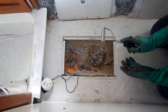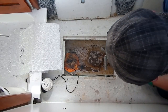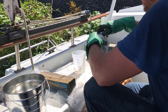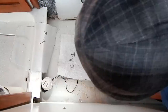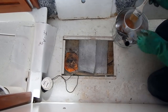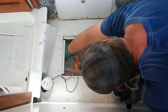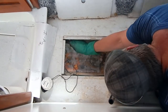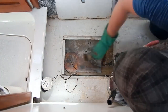All right. I think I'm going to go mix up one small batch so I can lay these two cover pieces in. And I'll do it because this hasn't obviously cured yet. It's going to take a while. But yeah, I'm going to layer that in right on top. Last batch, so 125 milliliters of resin, 25 milliliters of hardener, carrying in my metal bucket for safety. Final application of fiberglass and resin for this repair slash patch job. These two layers of fiberglass mat and cloth that I put down are really just to tie the whole patch in with the rest of the hull. I don't think they're actually necessary at all, but I've seen it recommended that you do stuff like this, so that's what I'm doing.